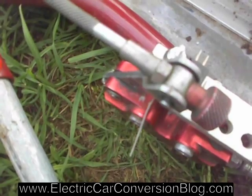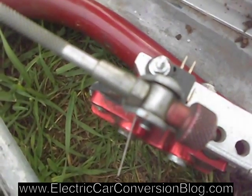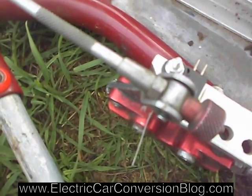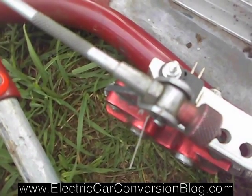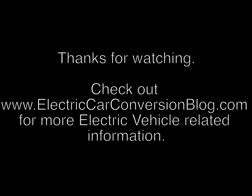It's not cutting power to the motor anymore when the brake is applied. That means with the micro switch disconnected, you can drive with your foot on the brake and foot on the accelerator at the same time. It just changes the driving characteristics slightly.